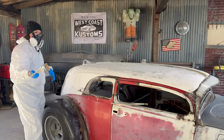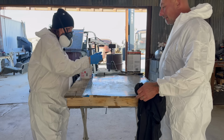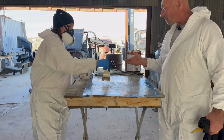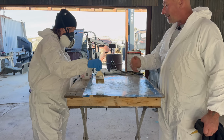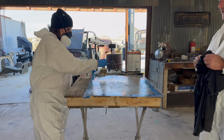Now that brush, swish it around good in the acetone to dilute that resin. Yeah, again, just a little bit of housekeeping, right? All this stuff that's standing up, the fibers, is going to be like sharp edges, and it'll mess up your next batch. It'll stick to it. So just kind of lay that out, clean up your surface, and we're on to the next.